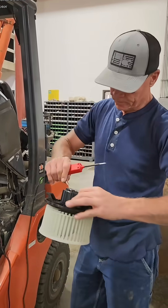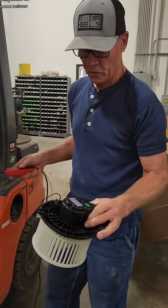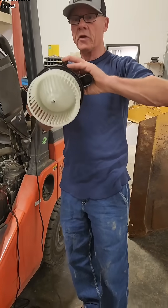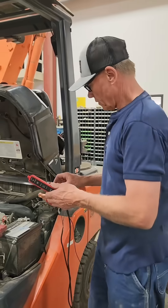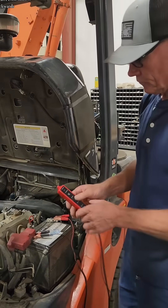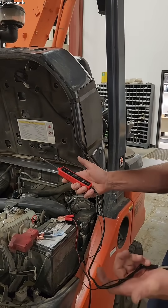Here's my favorite — a blower motor. There's a lot of components that run a blower motor: resistors, wiring, fuses. But what about the motor itself? Could it be bad? Not that one — it's a working unit. You really can't even hook it up backwards. If you do, it just operates backwards. No smoke, no trouble. It's just simply backwards.